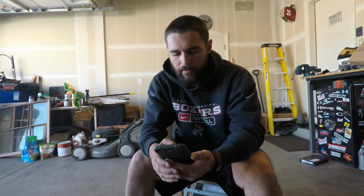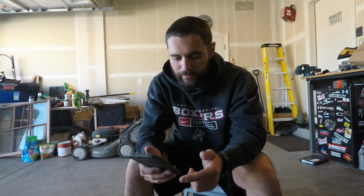If you already got that covered and you already have different plans, whatever, then yeah, absolutely. And if you have the heads off, I would definitely port them. My friend 454 Chewy, he's really good at doing it. Yeah, I would. I mean, if I had the engine apart and I was building it and you put flat top pistons in it, or if you bored the engine over so it breathed better. If it was just a stock 5.3, I wouldn't worry about it. I think there's other things you can do, but that's up to you.